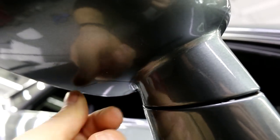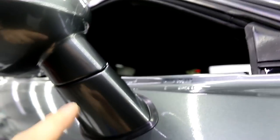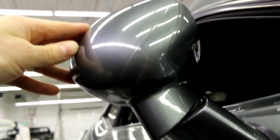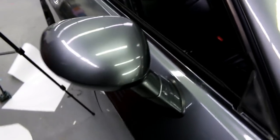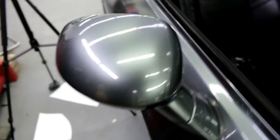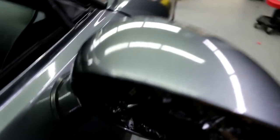Let's have a look at the seams. I've done an inlay in here — there is a natural seam in the plastic right here, that's a natural seam. There's a stone chip over here — nothing I can do about that. There's a natural seam also there that we followed all the way down with our first seam. It would have made more sense to probably put it on the inside of the mirror, but this is where the natural seam was — that's the way the manufacturer did it. I try to always follow it the same way. All the way around in here, as long as the lines are smooth, it doesn't look bad. The natural body line is more down here where they seamed it. I did it a little bit higher just to make sure we have good durability on the wrap. The inside here — I'm going to trim that out, make it nice and smooth, and then I'm going to put another piece on the inside to hold it all down. Super easy. Want to see the front?